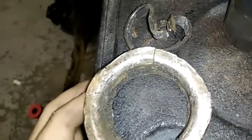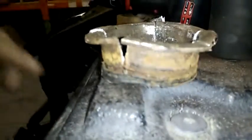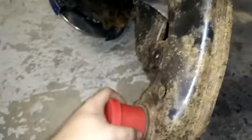And I kept on just wailing on it, and then finally I was able to get a pry between the subframe and here and work my way around with the pry, and then this pops out. So once you get that out, now you can actually fit this poly in here, but you're not done yet. This plastic here, this is on a sleeve of its own, and this can't come out till this comes out.